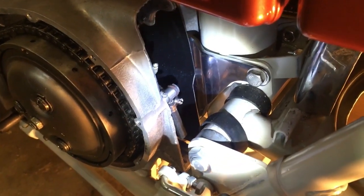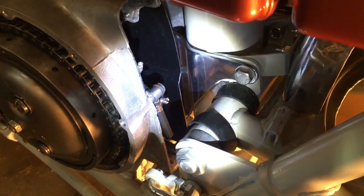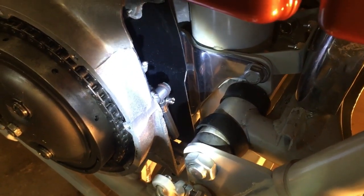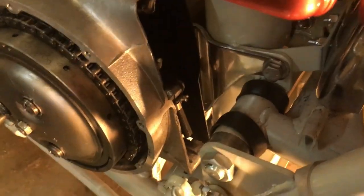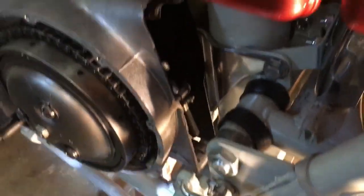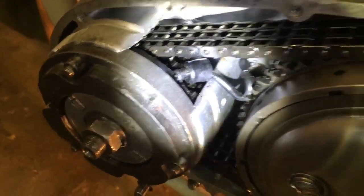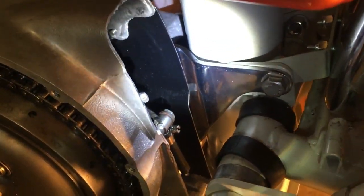Okay, I've just popped the chain guard off. I've taken the chain off because obviously we want to extend that as part of one of the jobs today. But can you see? The two bullets are peeping out there already. So let me just put the torch down. There they are, so that's good. So what I'll do is I'll now pull those through further so we can take up the bit of slack there, get that seal pushed on, and then we've just got to reroute those wires at the back of that